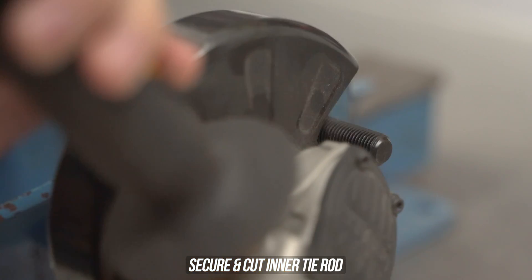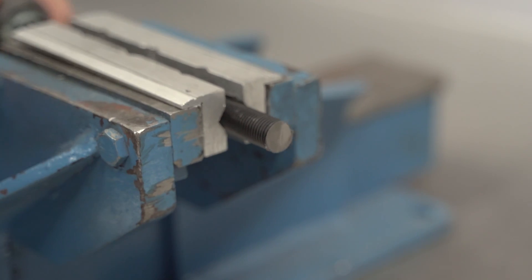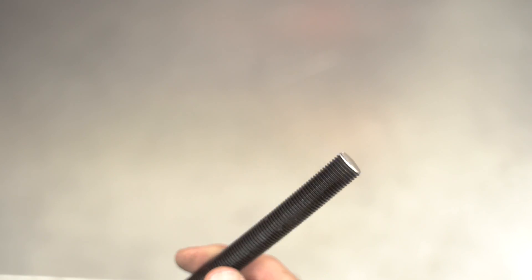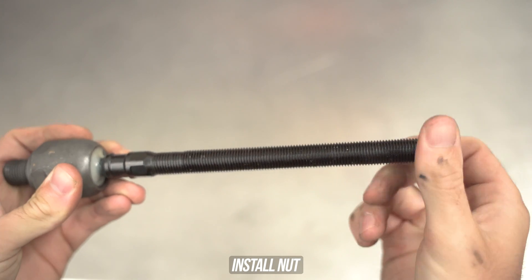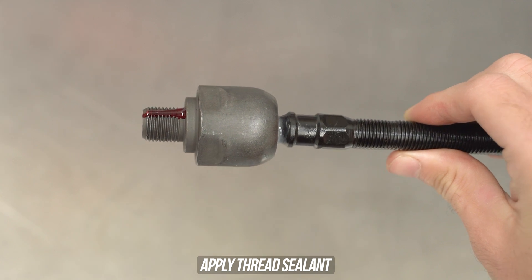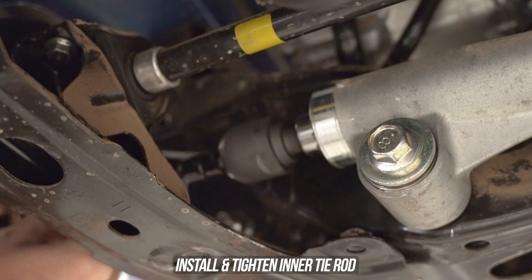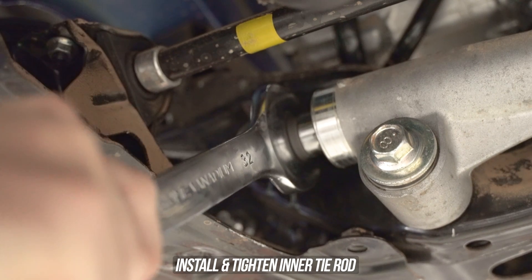However you clamp it, be careful not to damage the threads. Spin up that cutoff wheel and slice the end off. If you have a belt sander, go ahead and use that to bevel the end to make it nice and smooth — if not, just use concrete, but good luck. Test to make sure the locking nut goes on nice and easy. Now, since this is a steering component, please use your favorite thread locking compound while installing these units — we don't want these walking out when you need them most. Apply as shown and get back to the car to wind the inner into the rack.